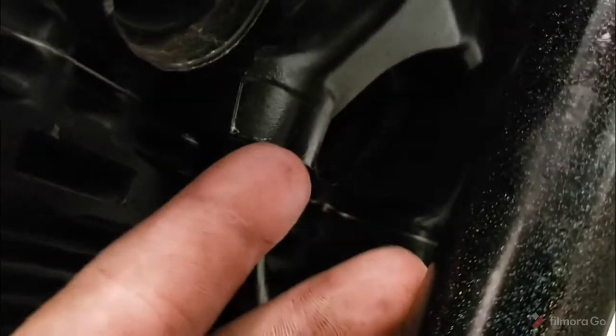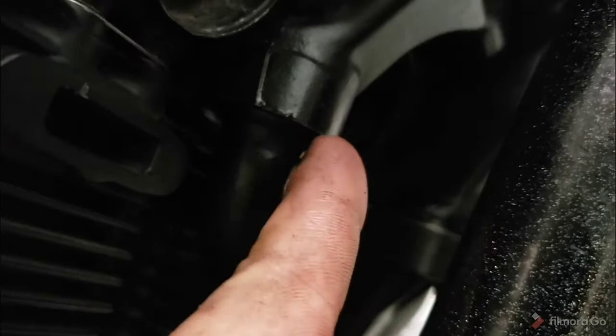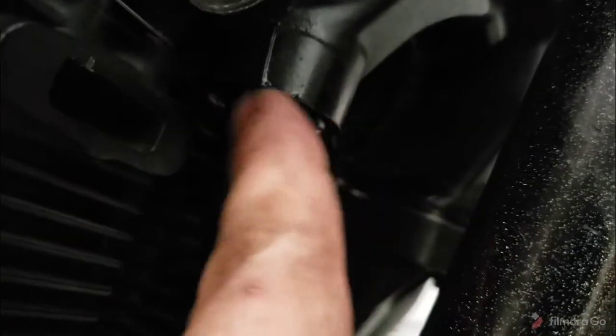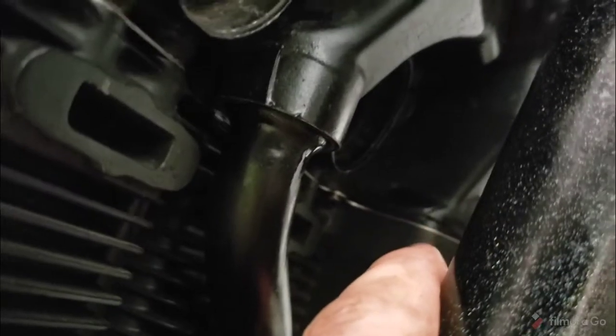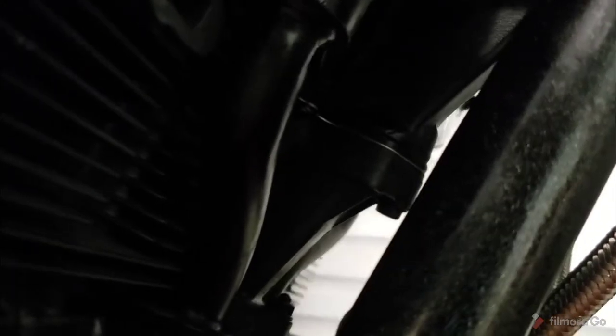It's pretty easy. One thing to note that may help you, I've previously done this, is to bevel the sharp edge that this O-ring goes into. I sanded mine down all the way to 600 grit, and then I lubed that and the O-ring before setting the head, and you saw it took just a light tap from a rubber mallet to go pop into place. Okay, that's a big one. And then don't forget your little 10 mil bolt down here, especially when taking the head off. You'll fight and fight and fight before you find it.